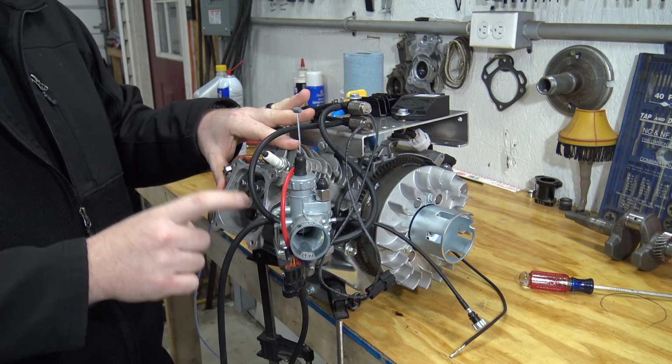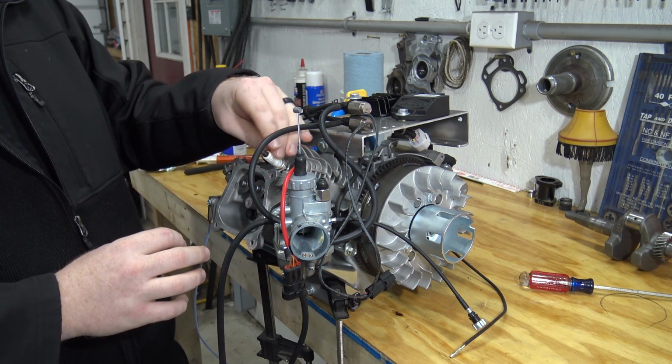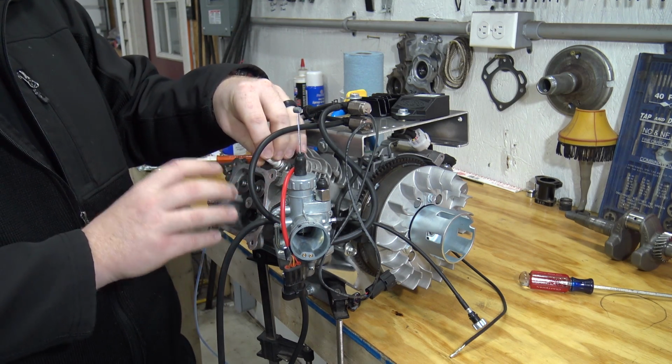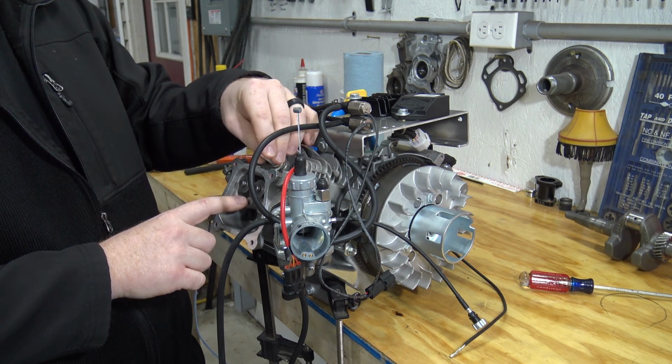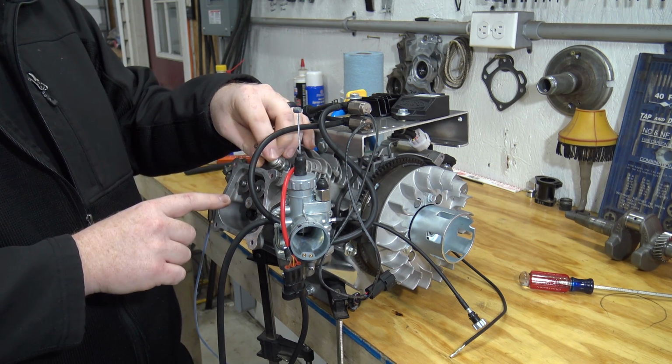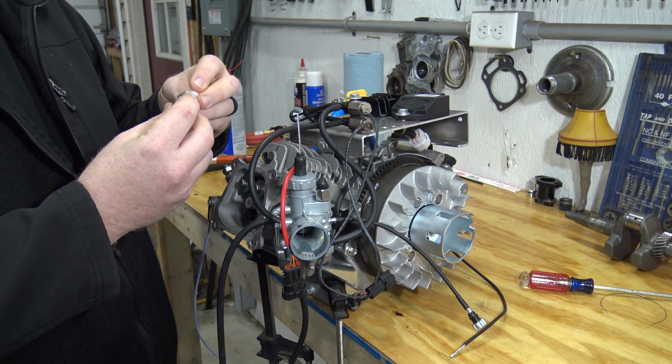We're gonna pull the head, and then I'm gonna pull the valves out, pull the spark plug, pull the carb and everything. Oh, spark plug's already loose. But basically pull the head off, get everything out of the head, and then I'm gonna weld to that broken stud until I get weld outside of the head, and then put a nut on it, weld it, and hopefully that heat will break that red Loctite.